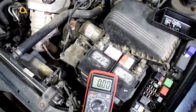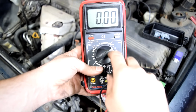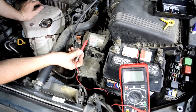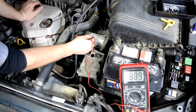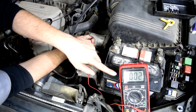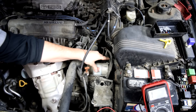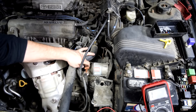The first thing I want to do is make sure our starter has a proper connection to ground. We set our multimeter to ohms on the continuity setting where we'll hear a beep when we have ground. We attach one test lead to our battery negative side and grab our other test lead and attach it to the casing of our starter motor — if you hear a beep that means we have ground. We got hardly any resistance and we're hearing a beep, so we do have ground in this starter motor. If you do this test and don't have ground, quickly wiggle your starter to make sure it's not loose, and look for signs of corrosion where your starter meets your engine.